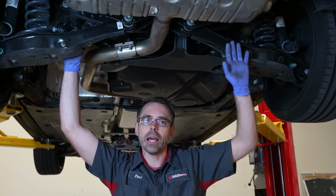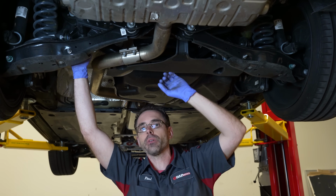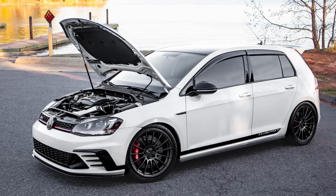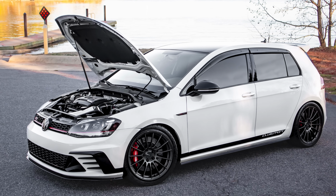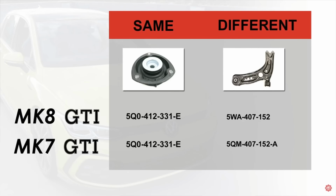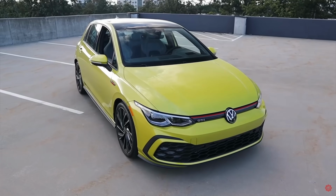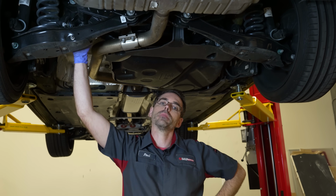Another thing people are often going to ask about is going to be the rear sway bar. The rear sway bar from the Mark 8 is different from the Mark 7 GTI, but it is the same as the Clubsport Mark 7 GTI because it's more aggressive. I know this because I did a comparison between all the part numbers on Mark 7s and Mark 8s on GTIs and Rs. We have two separate videos on that. If you're a nerd and you want to go super in depth and cover a lot of data in a short period of time, those are for you. We'll link to them in the description.